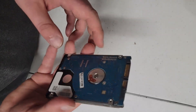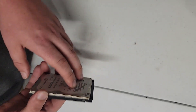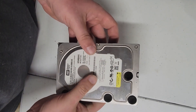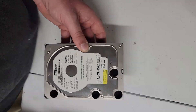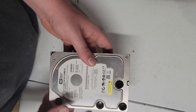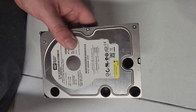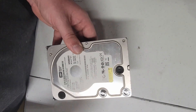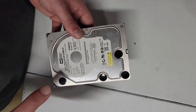This is a 2.5-inch hard drive — there is one spinning disk in here and the data is written to that disk, with a head that reads that data. This one is a 3.5-inch, which is what you're going to see inside servers or for mass storage. Most of these are bigger and a little bit cheaper. However, there is still spinning disk inside, and these have a higher chance of becoming corrupt due to data loss or just wear and tear. As a spinning disk spins, it's going to do damage, so hard drives are starting to go away, and we're moving more to SSDs.